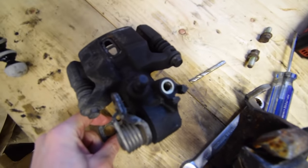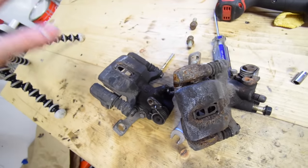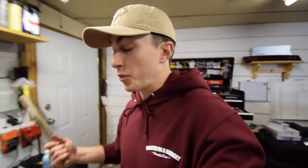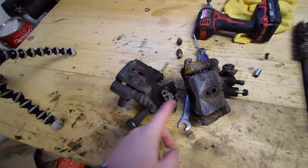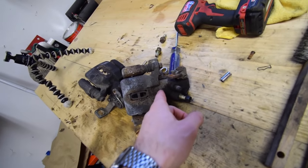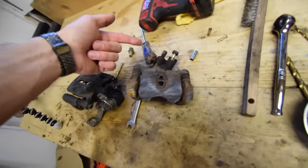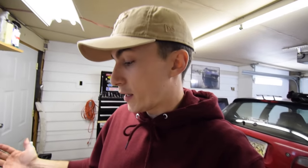This was my doing. When I undid all the bolts taking them home, I left the bolt that connects the brake line loose, so it leaked brake fluid all over the place. What I'm gonna do is brake clean it, get all that off, and clean up all this rubber as nicely as possible. Then I'm gonna wire brush and sandpaper - I've never painted brake calipers before. I understand the idea and I wanna make them look pretty nice. I know eventually I'll probably do a bigger brake swap because this car is gonna go a lot faster, but for now this is fine. I'm just gonna focus on the main areas you will see, like from the piston forwards.